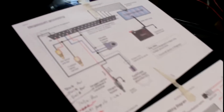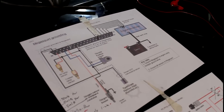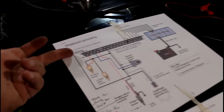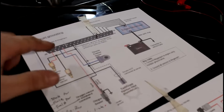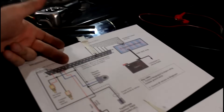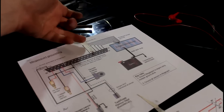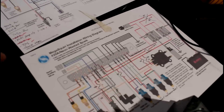Something else to talk about is the grounding system. I found this diagram on MS-Extra's website — search 'Megasquirt Grounding' and you'll find it. Essentially, a lot of these pins at the top are grounds 1 and 2, then 7 through 19, so from here all the way across are all ground. I'm not sure how you pick exactly which ones you want to use, but most ECUs, like this SimTech one, just pick about 5 of those and run them.